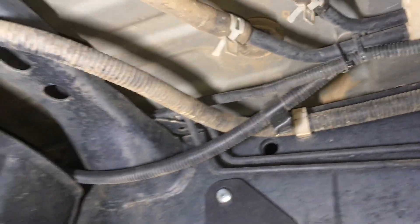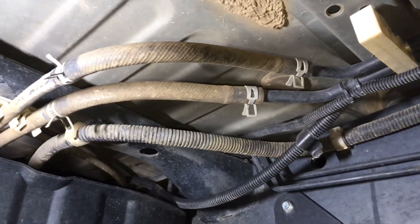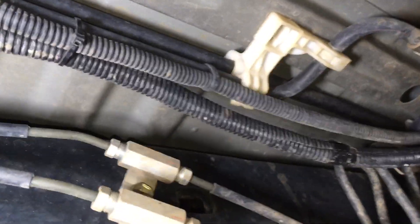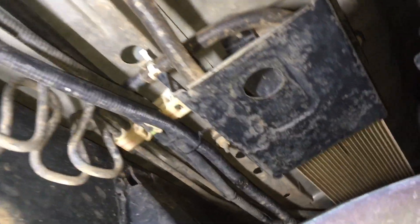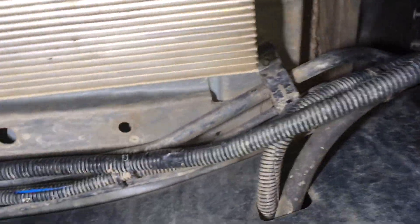This vehicle has some aftermarket accessories and some extra wiring. Personally I wouldn't have that wiring hanging down at all, because off-road sticks can easily get caught up underneath and yank it. See here where it's zip-tied and underneath — I would just have the wire pushed around so it's up above on the other side. See this other wire how it goes up and along the chassis? I much prefer that instead of hanging down there. Maybe I'm too fussy, but I just want those wires tucked up tight. Mechanically the vehicle is awesome though.